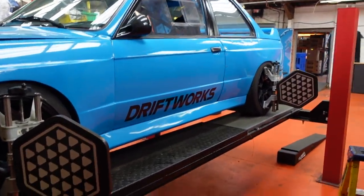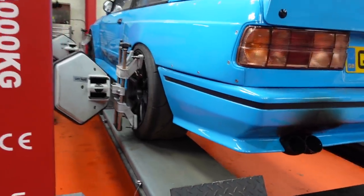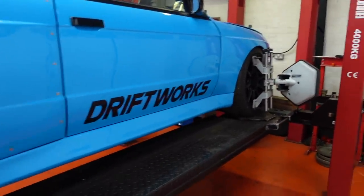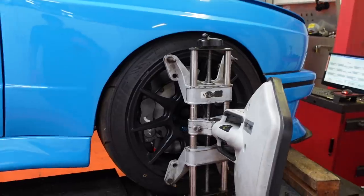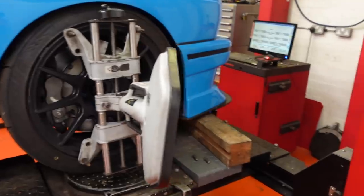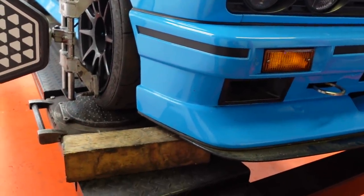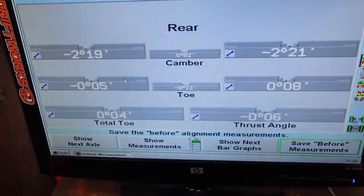Massive relief, because I really like the system and didn't want to replace it — potentially nearly £10,000 or more to replace. The plan with the E30 is to check the alignment, because we did some work to the front subframe moving the inboard mount on the front lower arm. I also need to adjust the drop links on the new improved front anti-roll bar, because the length will have possibly changed, and I don't want that pre-loading one side.